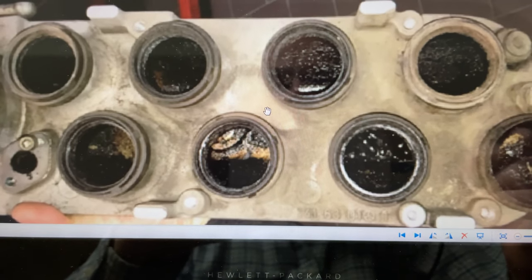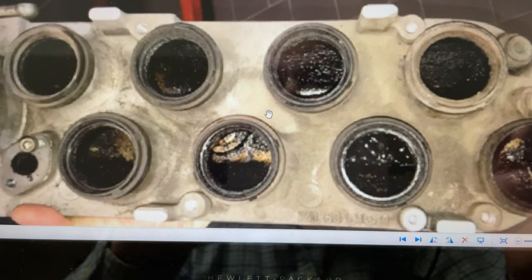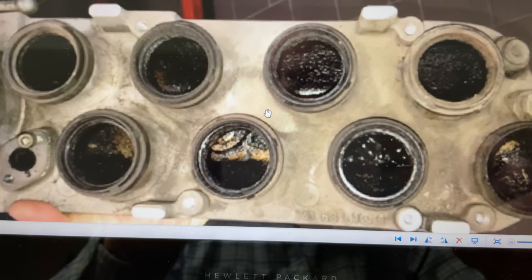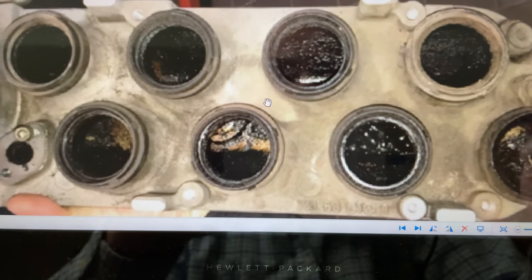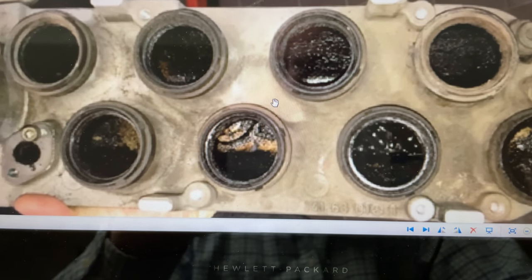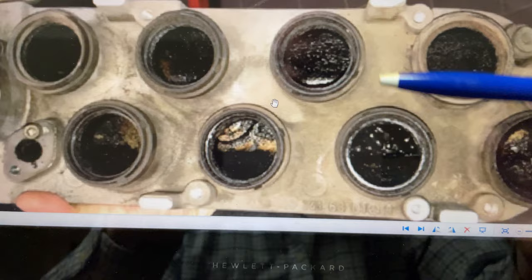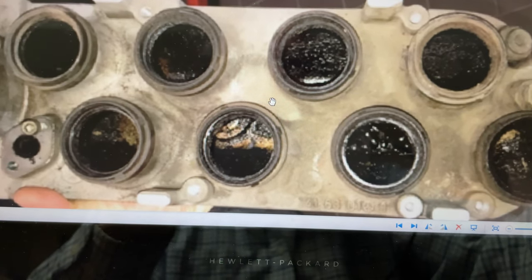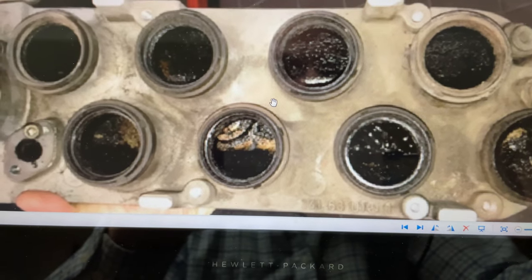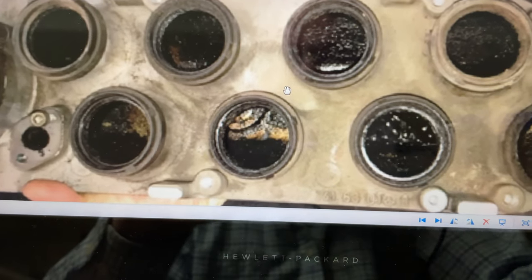I had to replace the ICV. I bought a gray market version made by Siemens/VDO which didn't meet Mercedes-Benz criteria — so it became a gray market item — for $225. It was made in Germany but is not 100% Mercedes spec. The OEM part is $650. The EHA valve also had to be ordered because the previous owner didn't want to go through cleaning and replacing these things. Instead, his mechanic adjusted the air mixture with the plate and the EHA valve to compensate for a failing ICV valve and the vacuum leaks here.